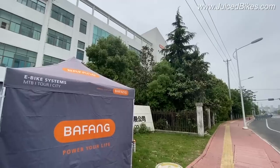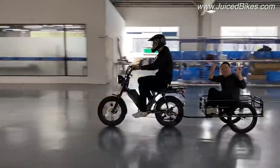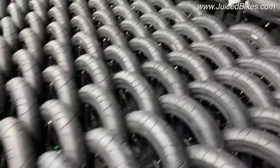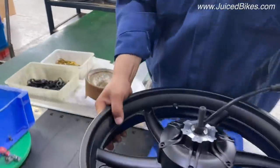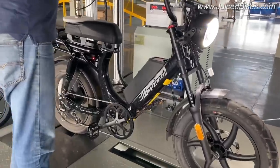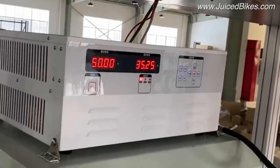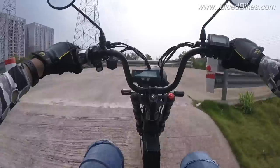We wanted this bike to do at least Class 3 performance — our target was 30 miles per hour on throttle alone on a 20-inch platform. No motor existed for that, so we went to one of the biggest motor manufacturers. We've been working with Bafang for about 10 years, and we told them: 20-inch, 4.0 fat tire, 30 mph capable, geared, and cassette-compatible. About a year later they delivered this motor and it's amazing. Peak power is around 1800 watts — 35 amps at 52 volts — which really exploits that 52-volt battery pack and gives very satisfying performance, pretty much all on the throttle.